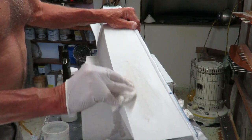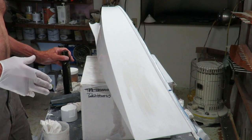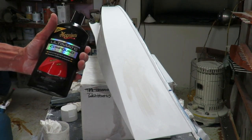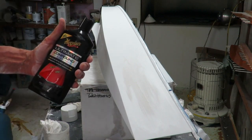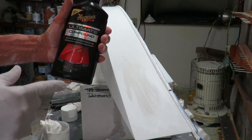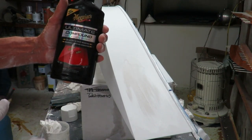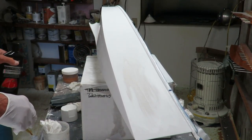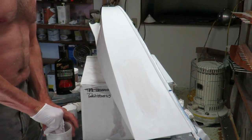With the buffing compounds, there are two approaches. You can use a series of four different compounds, from heavy cut to medium cut to fine cut to something often called swirl remover. So four different steps, each one being a finer grit. The other approach is to use a combined buffing compound. All the compounds I'm using today are Meguiar's. That works fine, but it's basically grit and a paste, and any manufacturer probably does pretty similar stuff. But these combined ones start cutting fast with fairly heavy grit, and then the grit breaks down as you polish it more to a fine grit. So they're supposed to be a one-step buffing compound. But overall, I think you do less work if you just use the four steps and get slightly better results, although it's probably not going to be that much different if you do a good job.